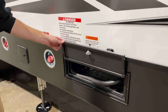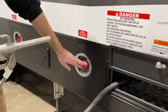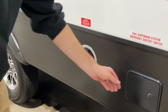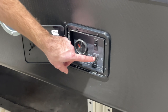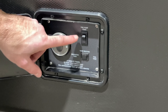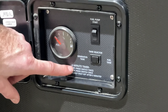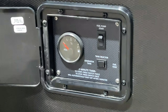Next, we're going to talk about your fuel center. This is your gas pump. The fill towards the rear of the camper is for your gas pump. The gas fill further towards the front is for your generator. You have a gauge and a switch — the bottom switch is your tank selector so you can select the gauge between the generator tank or fuel dispense tank. The top switch is your fuel pump on/off. To start the fuel pump, press the switch twice. To stop it, push the switch once. It will automatically shut off after five minutes of not being used.